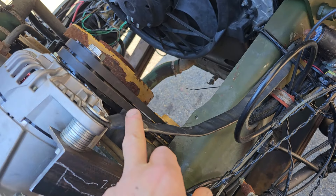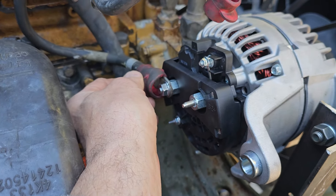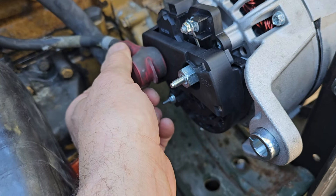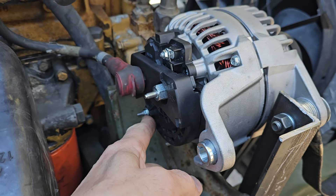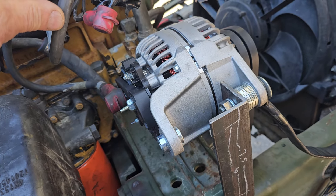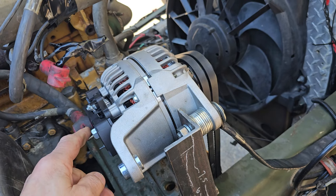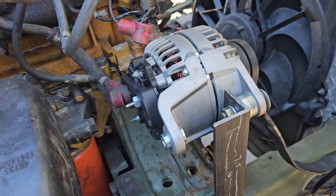This is the ground strap that was in there. As far as the wiring goes, it comes with a few options back here — one's a big lug, one's a small one. You take the big one and use the original 12-volt output cable, and it goes through the diodes to the battery. That's all you need — there are no other wires. Normally you'd have one for an exciter for the field, but this doesn't require it — it's done internally. The 24-volt feed that normally comes in is just taped off, as well as the old regulator wires. I'll pull these back and make them nice later, but right now this is all working.